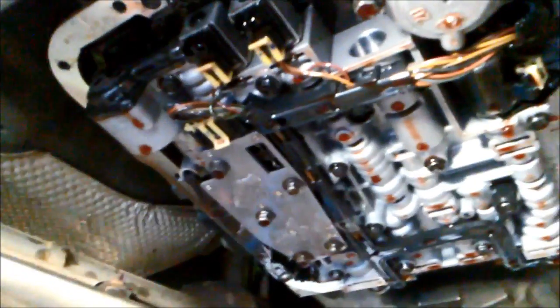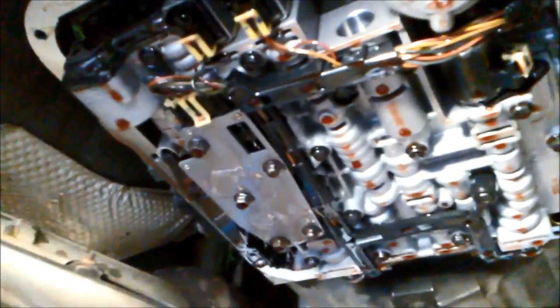We'll check the tension on these bolts with a torque wrench, just to make sure they're all nice and tight. If you over-tighten into alloy, because metal bolts and alloy have different heating and cooling rates they'll move over time, and some bolts can become loose — so it's a good idea to just check everything.